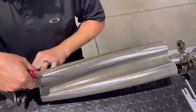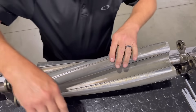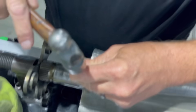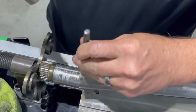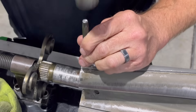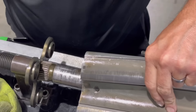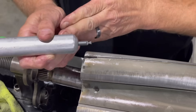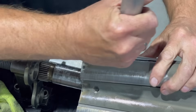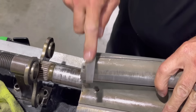So right now I'm going to take out the OD strips. I'm just using a pick to pull it up and you'll see that these strips are just curled up. They've been so hot. There's an area here on the end of one lobe that is way opened up — it was actually missing material after it was run. So I'm just going to kind of stake this thing down and get it close to where it needs to be, then take this tool that we made years ago and just pull it down through the groove itself. Now I'm just going to knock the top edges off those stake marks that I put on there.